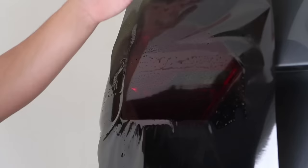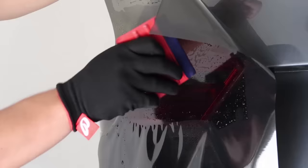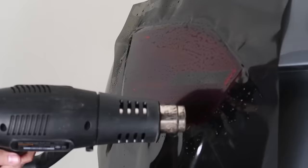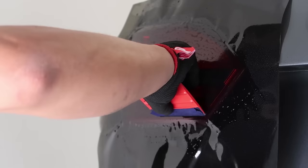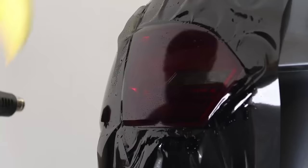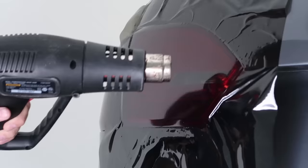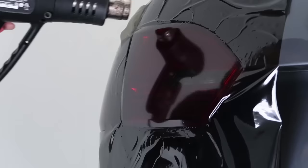Right now this portion of the light is what I focused on — I also have to work my way up and down eventually. You just lift this and push the water out towards the top, always working towards the edge. Because the light is a little rounded in this section about a half inch down, we're going to heat it into place and work the material down. You want to dry off the light and heat it up — the heat will tell you if there's any water left behind because you'll see it bubble up. In this case nothing's bubbling up.